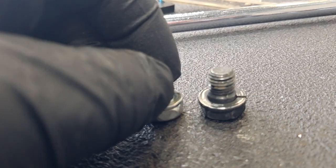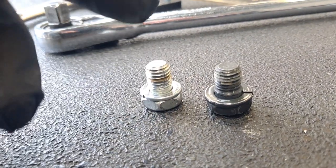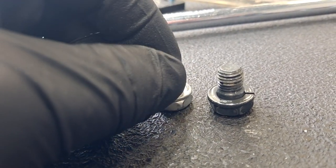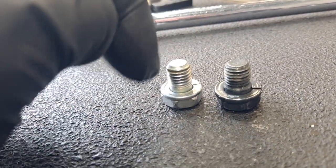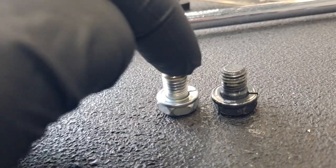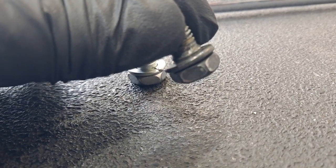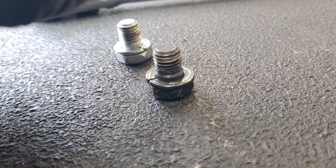If you were to start with a silver one, the way that other manufacturers do it, all the bolts are the same, you just start all six in this case, or three or whatever the number is, you start all six, and then you go through another round of crankshaft rotations and torque, torque, torque, torque, torque, torque. But in this one, this alignment shoulder allows you to put them in and torque them right away without having to do two revolutions and two rounds of torquing.